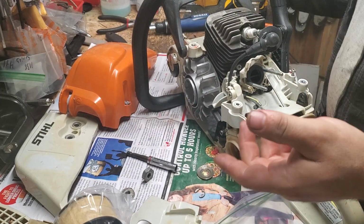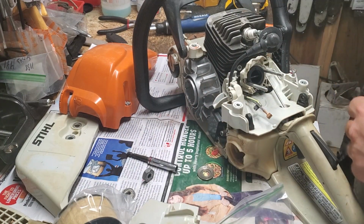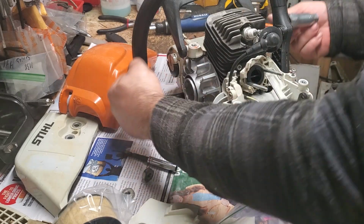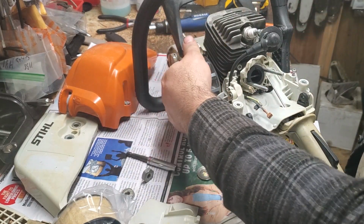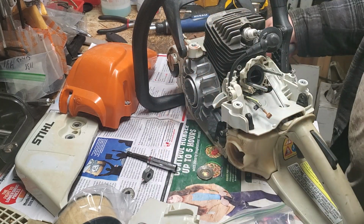Guys say you can damage your crankshaft. I've never had that issue. So please, again, hand tighten, rope down your piston or use a piston stop, preferably. Or you could technically do the two wrenches. You could take your 13 over here to hold this and then tighten it.